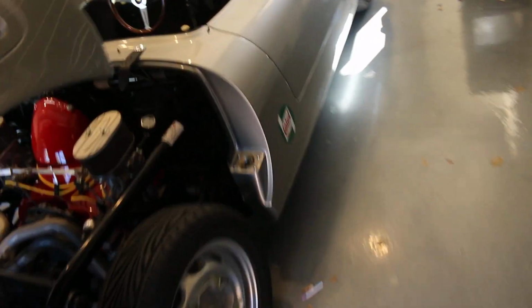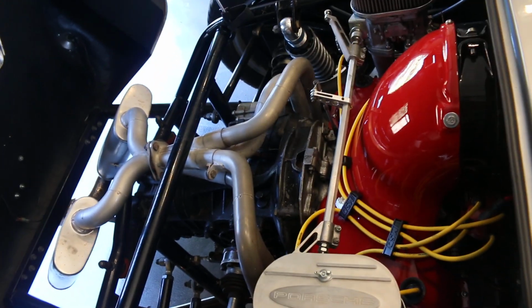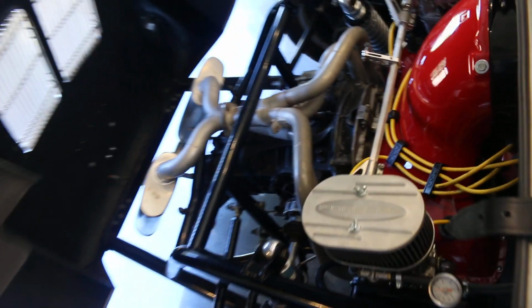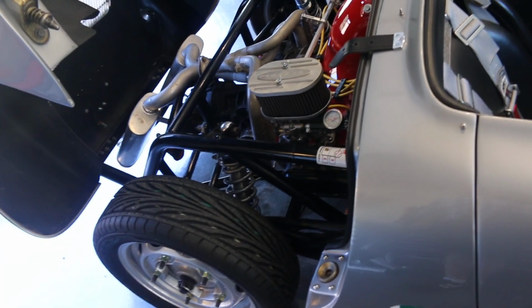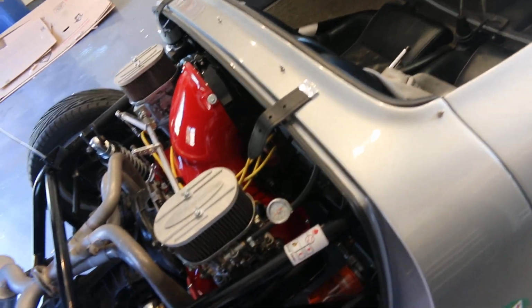Oh, brakes, right. Yeah, rear brakes are 356B Porsche brakes, drums, and then in the front it's discs, and it's an adapted Rabbit system. All those parts are still available. I never had to replace them, but they're all still around. I've just really fine-tuned the car as I've owned it. For example, somebody was selling these nice brushed aluminum covers, and I got those. This is a standard K&N filter. The Webers are 44s. They're jetted pretty big. It runs well. It's a lot of power.